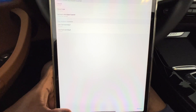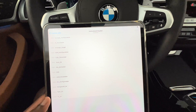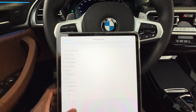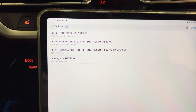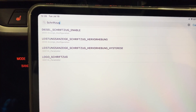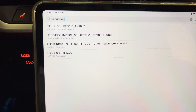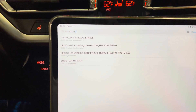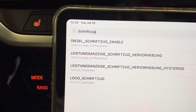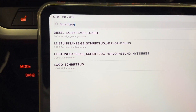This adapter is rapid — really fast. Go down to Expert Mode in the left-hand corner, click on that, and once you're in, pull down on the screen to bring up the search bar. Once the search bar appears, go ahead and type in the word 'schriftzug' — it's a German word, not sure exactly what it means, maybe logo or instrument cluster.